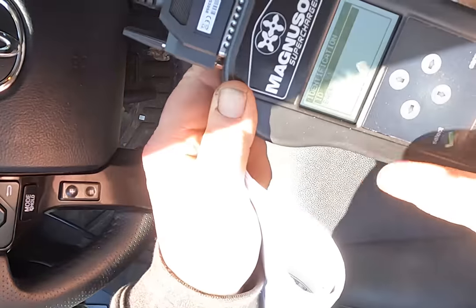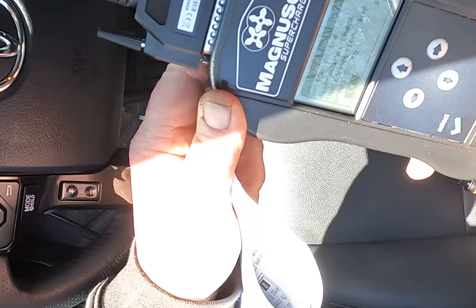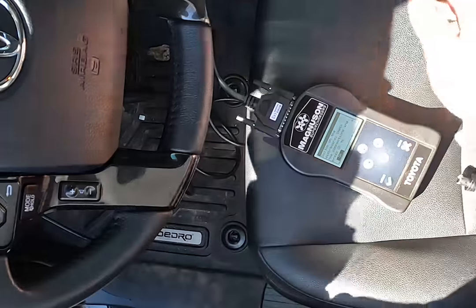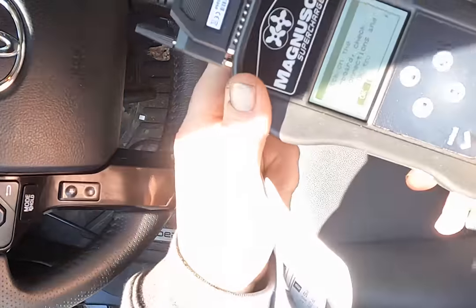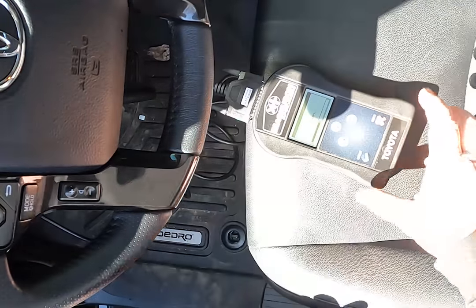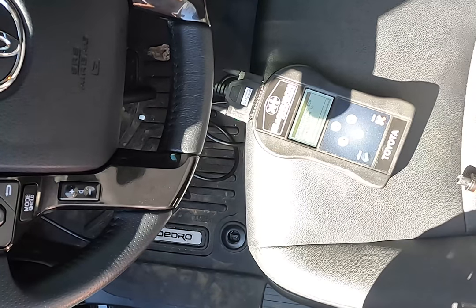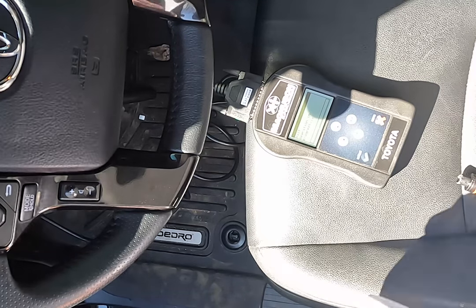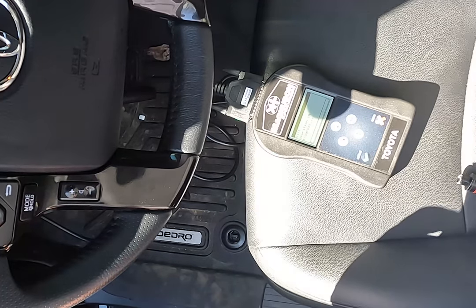And the handheld will start doing its job, and just wait. The ECU will be identified. The file will be processed, and it'll say file processing in progress right on the screen. And then writing preparation in progress will show up. The mod file will be loaded, and you'll see it say ECU programming, and it should say mygfifile0.mod. Once again, it'll prompt you to switch off the dashboard to continue, then click OK.